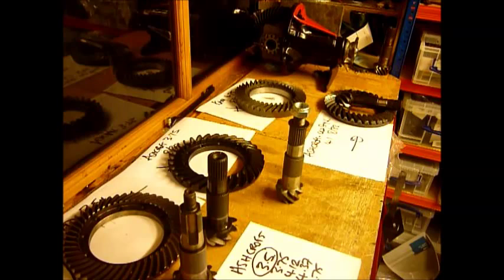If you over-gear the vehicle you'll theoretically have a top speed of about 200 miles an hour, but in actual fact 5th gear becomes useless — with 35-inch tyres on a standard 90, driving down the motorway it will slowly just slow down. Whereas if you under-gear it, 0-60 will impress people, except you won't get to 60 — you'll get to about 40 miles an hour, the engine will be screaming and you're flat out. So it's really important you get the gearing right. In the next video we'll show you what effect gearing has with various ratios on crown wheels, pinions, transfer boxes, and tyres, and how you go about choosing the right ratio for your truck.